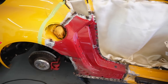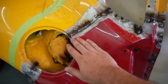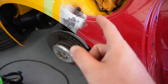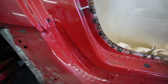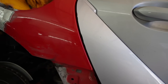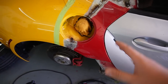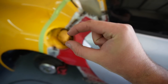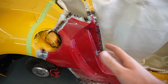Using our Harbor Freight welder, he did the best that he could and honestly this came out pretty dang good. Everything is sealed up really, really nicely. We did all the prep work that is needed. Now we are going to be grinding all of this off and sanding this all down. That just looks so, so good. If you guys check out all of that, that's definitely going to have that OEM look we've been looking for. The door gap — look at that fitment, that looks so good, everything is so flush. Once we put our gas cap and everything back on, it's going to be so nice. This is the proper way to do it, because every time you close the door now we're not going to be cracking Bondo — the Bondo we would have had to put would have been this thick, which would have been absolutely insane.